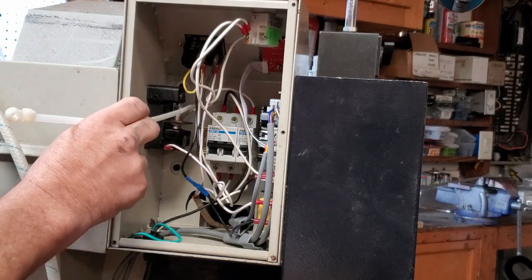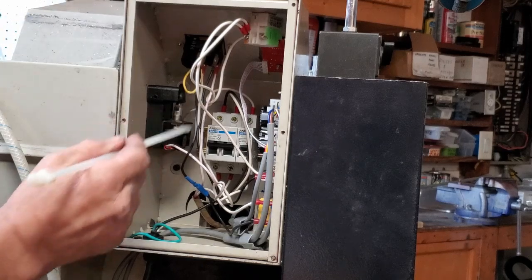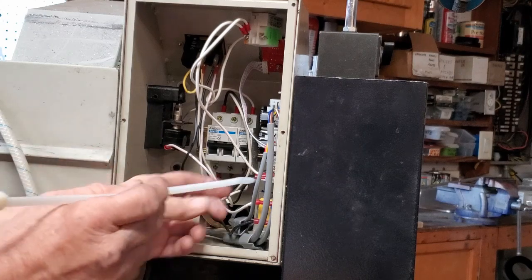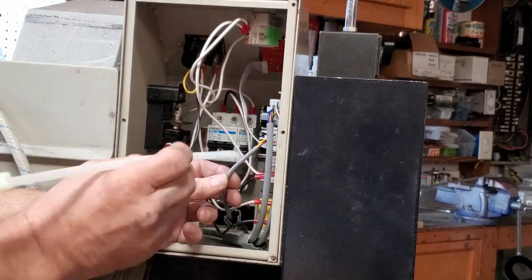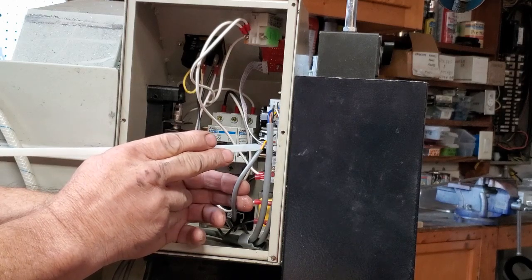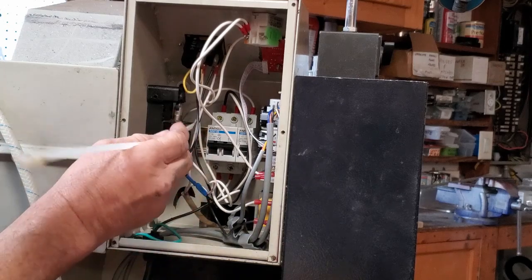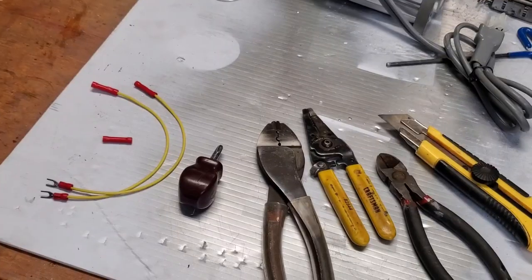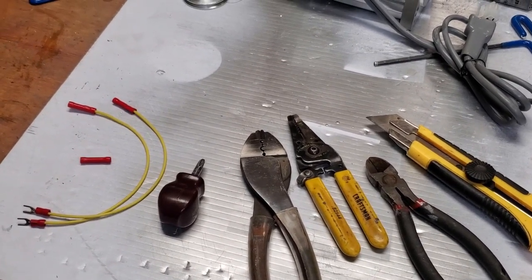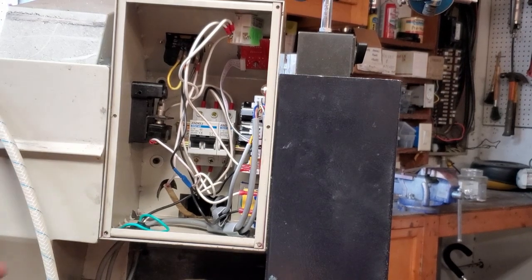What I'm going to do is take the two wires off of this door switch and just connect them together with a butt connector. Then we're going to go over to the speed control switch, split this housing a little bit, cut this yellow wire, put a couple of pieces of wire on it, and hook it up to this switch. To do this job I'm only going to use these tools, and those are the wires I made up to do the job.